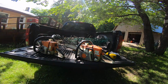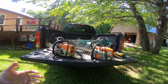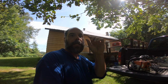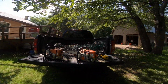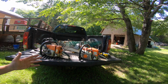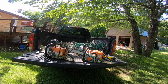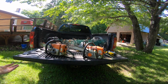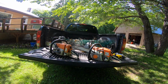So I'm thinking probably the float and the fuel lines. Even if it's not cracked, what happens with some of this old fuel line is it gets really weak, and when you start, it squeezes in on itself. So I think it's just regular maintenance for these saws. I'm going to take them to the Stihl shop in the fall, if I have a bit of money, and say, okay, test everything, test the coil. I could sort of test things myself, but I just don't have time, right?